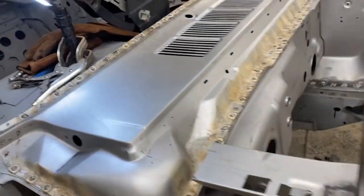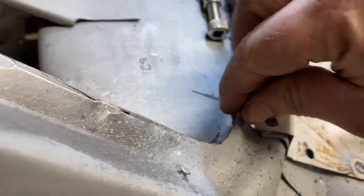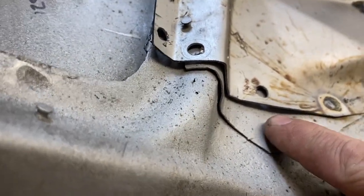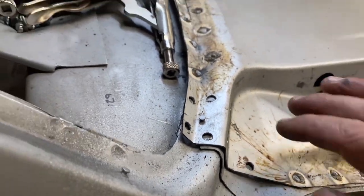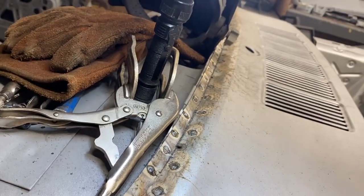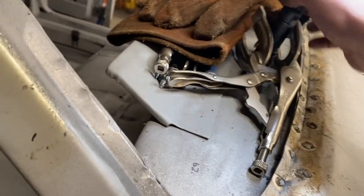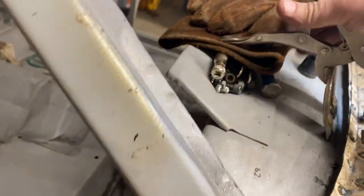And that'll be done. On this corner, which I wanted to show you before I welded it in, you can see this is sticking up a little bit. I've got a bit of a gap here and I've got a decently large gap there. It actually was much worse than the other side. But what was important to know, because you may run into this too, is the whole middle part of the windshield just laid down really nice and flat. Super easy to clamp them in with these type of clamps, like such.